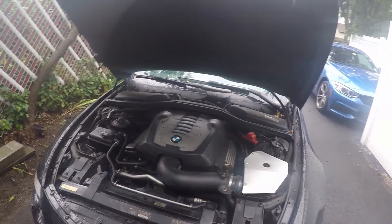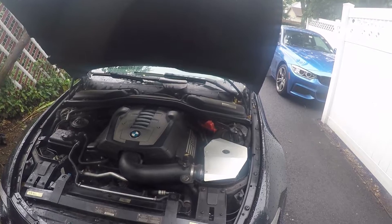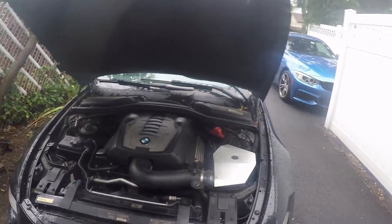Those are my tips. I have pretty much no sign of oil leaks anymore. My engine's dirty but I'm going to leave it that way because if I clean it, it'll probably free up some leak somewhere. These products have really helped me. Until my valve stem seals get to the point where the AT-205 Reseal is no longer cutting it, that'll be end of life for this vehicle for me. But in the meantime it's gotten me several more years of life out of this engine without leaving oil puddles wherever I go. Old faithful is alive with these additives — hopefully that helps some of you guys.